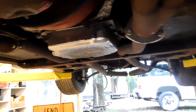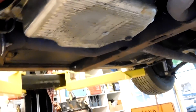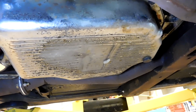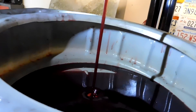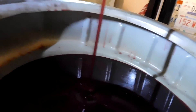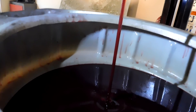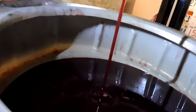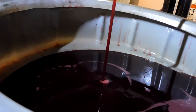The main thing we're going to focus on today is this transmission. Normally transmissions don't leak water into them because there are hoods on cars, but I'm just not going to take a chance on this one. Since it has a nifty drain plug, it's worth draining it just to see what's in it and how much is left. The transmission fluid came out — I don't see any water, any multicolored stuff, or gunk, like when water interacts with oil. The plan is to drain this, check it, refill it, and make sure we're good before we hook up the engine to the torque converter.